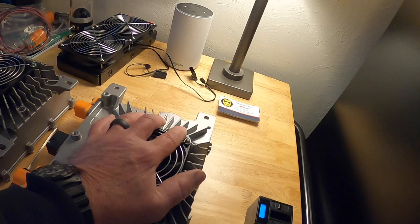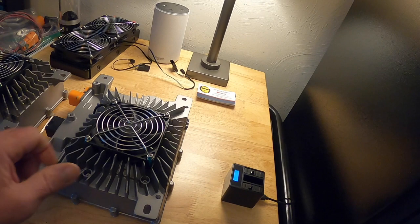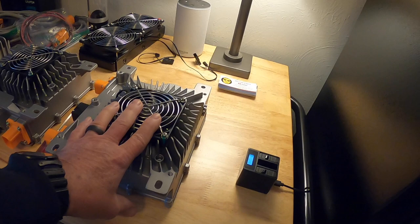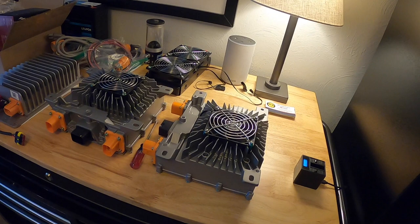This is the AC charger. This is going to convert the 230 volts AC coming from the wall charger plug-in — I showed in the last video where I flip open the fuel door and plug it in — and this is going to convert it down to 150 volts DC to charge the battery pack. This is a 3.3 kilowatt unit and I have two of them, so wired in parallel giving me a total charge capacity of 6.6 kilowatts when I plug into a 30 or 40 amp wall charger.